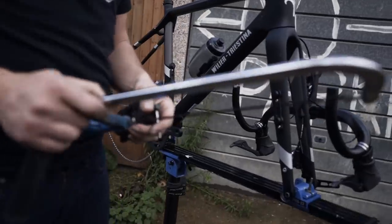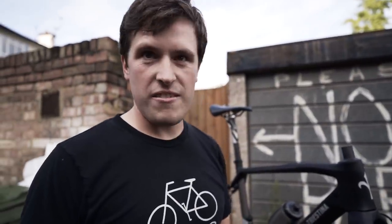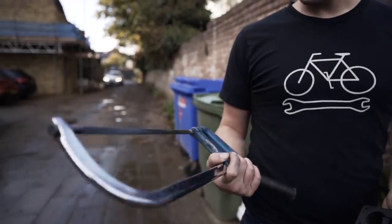Great success. Have you used a carbon blade on it? No — I find that they don't cut very well. I find that it always seems to break through the end of the steerer. With these, obviously if you force it through it's going to snap the carbon strands, but if you let it cut — let it do the work, let it do the cutting — it's a lot cleaner on the exit. That's just a normal hacksaw then? Yeah.